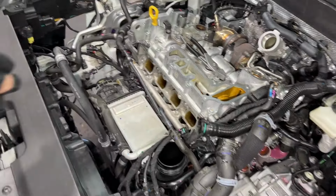Okay, one little bracket, 230 right down here, we've got to get. A little water pump out, keep the direction the same. All right, three there. Got a little bracket there. Tensioner. Loosen the timing belt tensioner. Yeah. What size? 13.